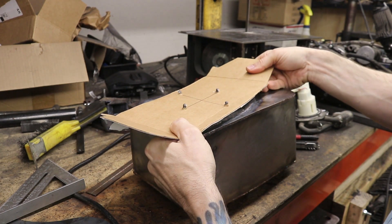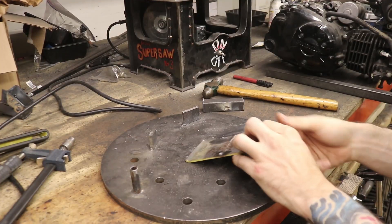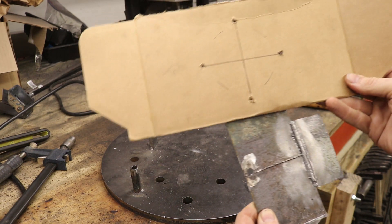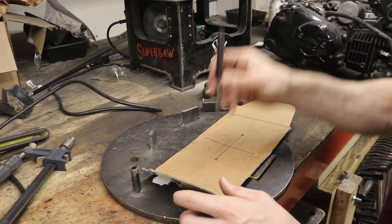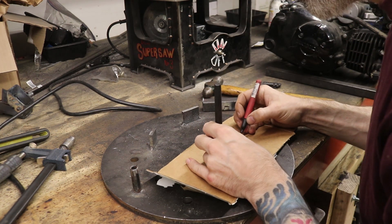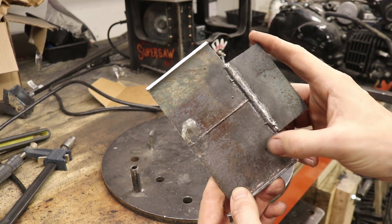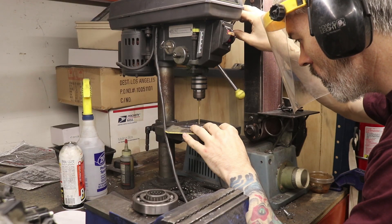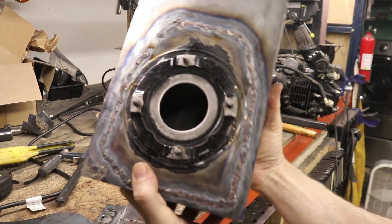Now we can transfer this onto a piece of metal. I just made this little piece here — welded that thing onto this thing — so now we've got a piece that will span the distance we needed, to fit on there. I already drilled one hole, so I'll line that up and mark the other ones. There's our other ones marked — one there, one here, one down here. Now I'm going to mark them with my center punch and drill those out. All four holes are drilled.